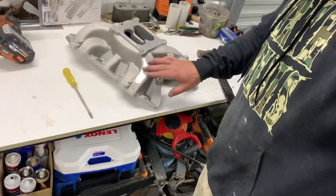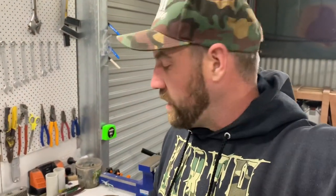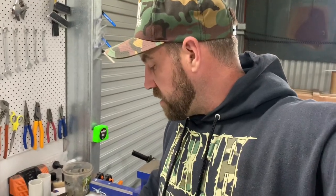So I've got all that nice and smooth. I've tried not to go too hardcore. I definitely should have masked up the plenum there, so don't tell my engine builder, but I'll give that a good blowout and clean it up. And now for my trick to make this look like it's been cast again — because obviously it's now shiny — onto my little air scaler. I use this to put the textured pattern back into the metal. And then depending on how that comes up, we can also give it a bit of a light sandblast as well, which makes it look even a little bit better.